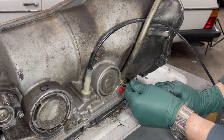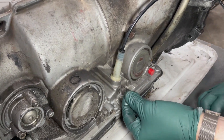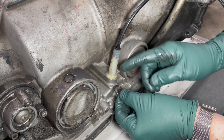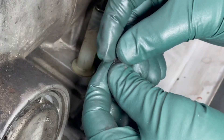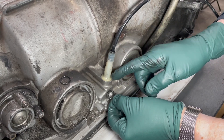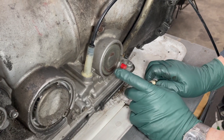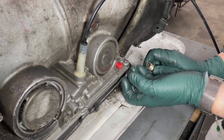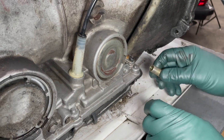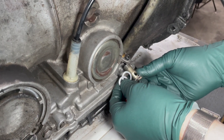The fill tube o-ring is a very common leak — it'll just drip out after sitting for 40 years. The smaller o-ring is for the Bowden cable, and people are having a hard time obtaining this one; it's really not available and I had to special-source it. This is the toughest one to replace — I generally do it when I remove the transmission. Also, after removing the trans cooler lines, use silicone plugs to keep those holes plugged while cleaning. There's also a banjo bolt on this side, and I use the other two sealing rings in the kit to replace those during this service.